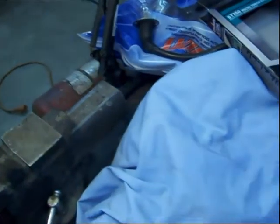Everything is painted. All the sockets have been rebuilt, I re-soldered my grounds, installed one new wire from another harness, and got some dielectric grease on there. We're going to test to make sure these things work. That'd be your parking light. That'd be your turn signal. Parking light. Turn signal. It's a good idea to check those before you put the whole thing together. As soon as we get the new lenses, I'll be able to assemble these turn signals.